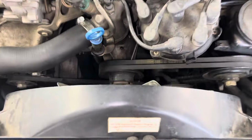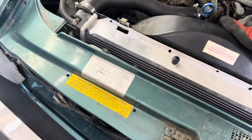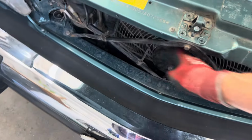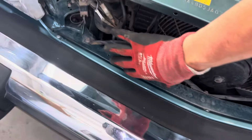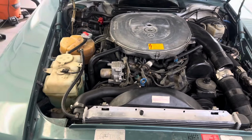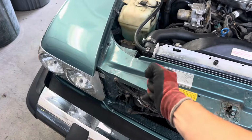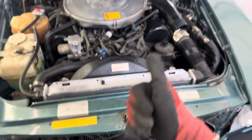For the thermal fan clutch, sometimes, without cutting off your fingers, we have the bad habit of the unapproved way of holding the old fan and possibly losing some fingernails if you don't be smart about it, and driving the pressure up. Or you could slip some cardboard down in here and totally block off the air. Watch the high side go up to 270 psi. The switch will close its contacts, telling the contactor to turn on the fan. All right, catch you in the next video on this one.